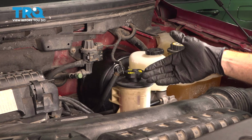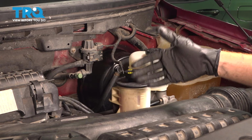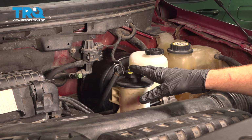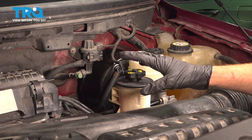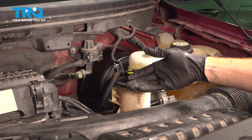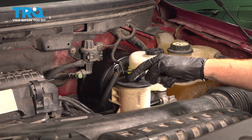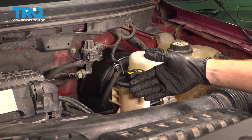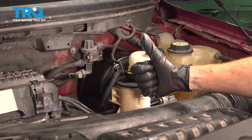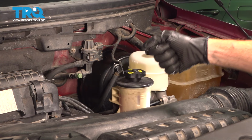Okay friend, we finished our installation. The next thing we need to do is make sure that we've cleaned all of our mess. After that, start the vehicle, let it run for a short while, and make sure you don't hear any odd noises. If you hear an odd humming or a whining noise, more than likely you still have air in the system and you need to continue the bleed. Aside from that, just double check to make sure you have no leaks, close the hood, take your vehicle for a road test. Thanks for watching.